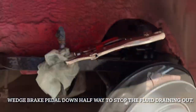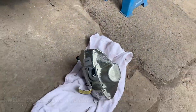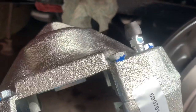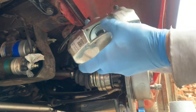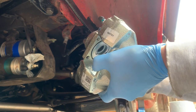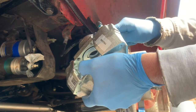I was hoping to avoid draining all the brake fluid out but that didn't work, so we're just going to top up the fluid and bleed some of the brake fluid out at the bottom valve. What we're going to do is take out the cap here and screw the caliper onto that fitting first. Just be careful not to twist the hose when you do this — that's a 14mm fitting.